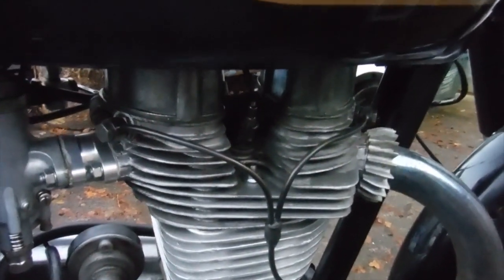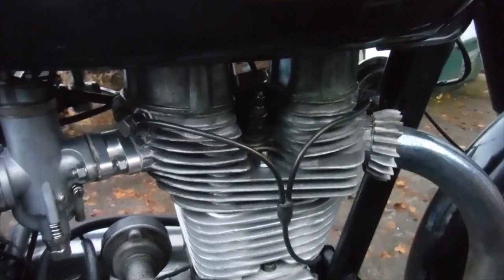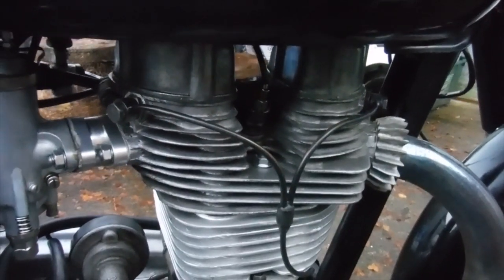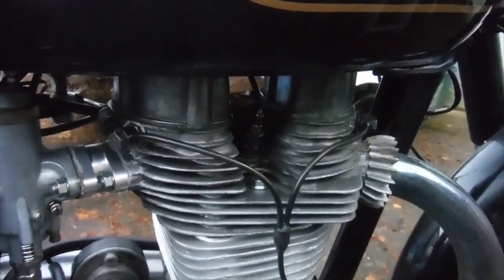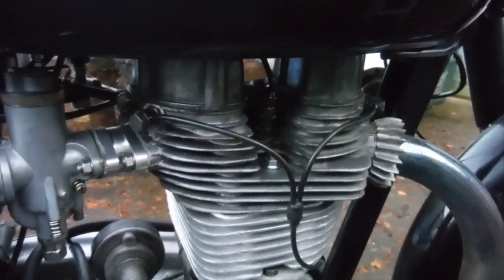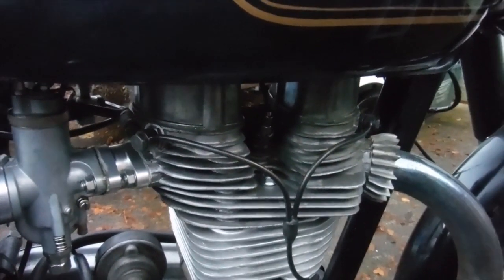We've got a new exhaust valve, an oversized one, which came about from my suggestion to Hitchcock's. It's just to get a little more contact area between the valve and the valve seat on some of these Indian ones, where only the inner part of the valve seat circumference is touched by the valve, and you can get rapid valve seat recession as a result. So these exhaust valves are about a millimetre and a half bigger in diameter and just seat that bit nicer.